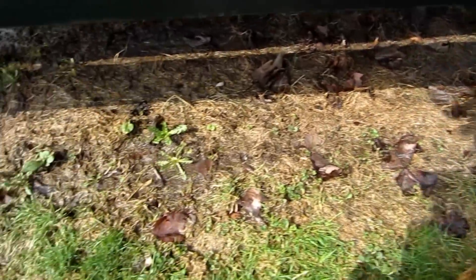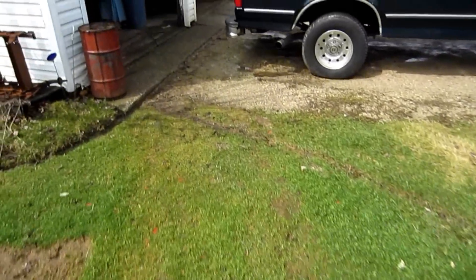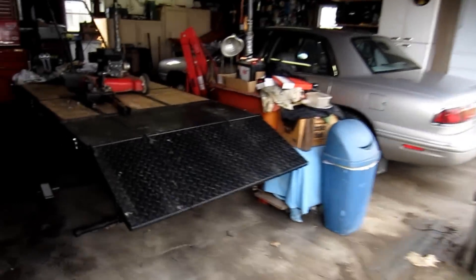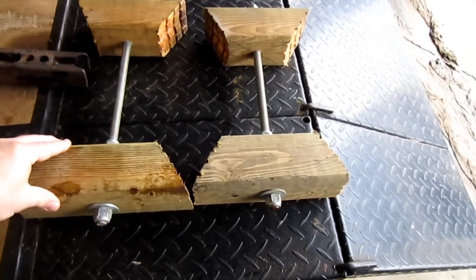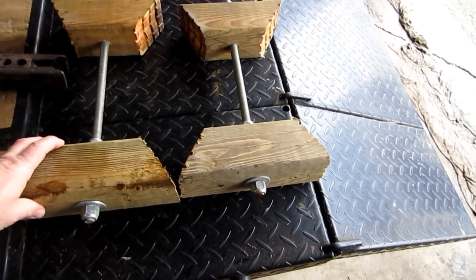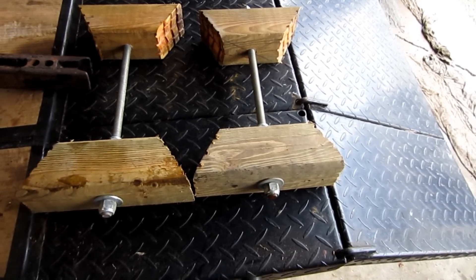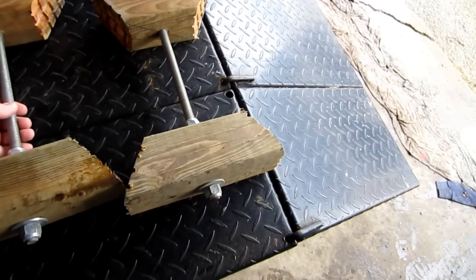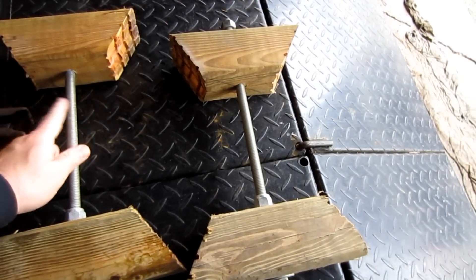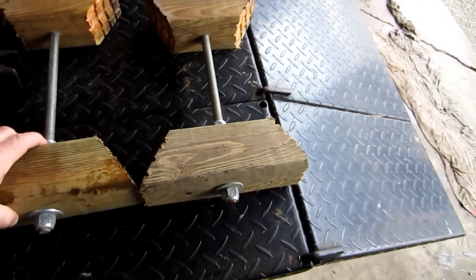Okay so I got what I wanted to show you. Let's go in the garage and lay these out on the table so you can see them. Here you can see my homemade wheel chocks — not my design, but I made a little bit of a variation on what I saw online. What you need is 5/8" all-thread — that's the size diameter-wise — and you need at least 36 inches of it.